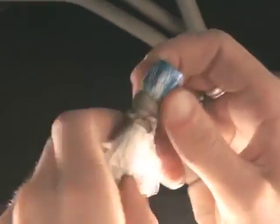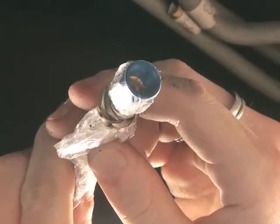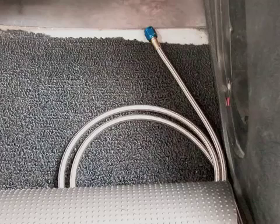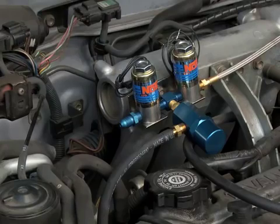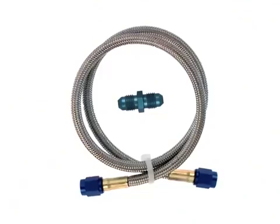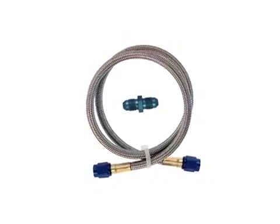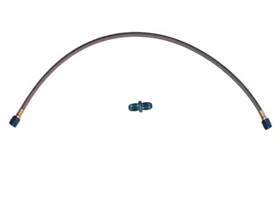Before you run the hose in the interior or along the undercarriage, wrap the end of the hose with a couple layers of plastic wrap or a small plastic bag and secure it in place with a rubber band to keep debris out of the open end of the hose. After the line has been run, excessive hose length can be coiled and easily concealed. However, braided high pressure hoses can never be cut and shortened because of the carefully machined ends and compression type connectors. If your hose path causes you to end up short of the proposed mounting point for your NOS solenoid, you can purchase a two-foot high-pressure line extension that will finish off the path and still let you retain the longer route that you initially ran the hose along.